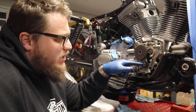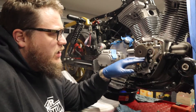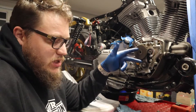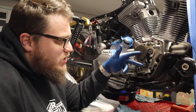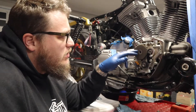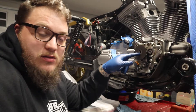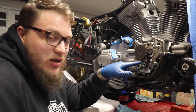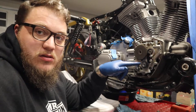Once these are lined up, I'm gonna pop both of these off, put the chain on, and put them back on. I have two new bolts — the manual says to get new bolts anyway — and they came with my gasket kit. It says to put threadlocker on the rear cam sprocket bolt, but do not put threadlocker on the other one.